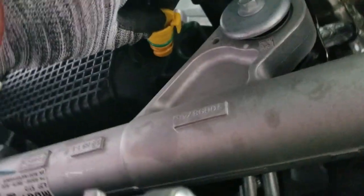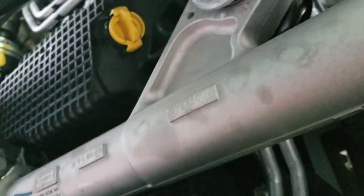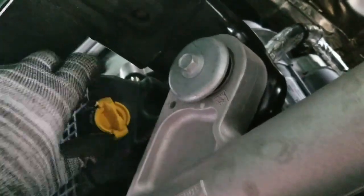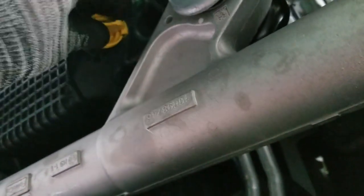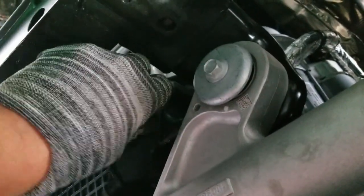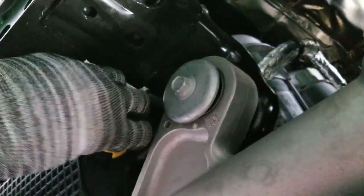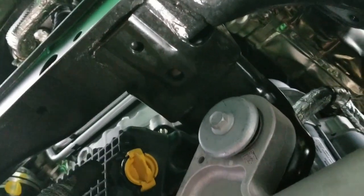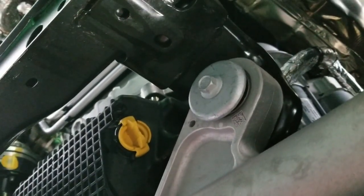I'm doing this almost blindly without my glasses. I put it in, give it a turn, and it just clicks — look how easy that is. The o-ring is well lubricated, no problem at all. I'll wipe the excess oil off the plug and the cross member just to be professional. I'll leave the skid plate off until I check for leaks — it would be silly to reinstall it before verifying no leaks.